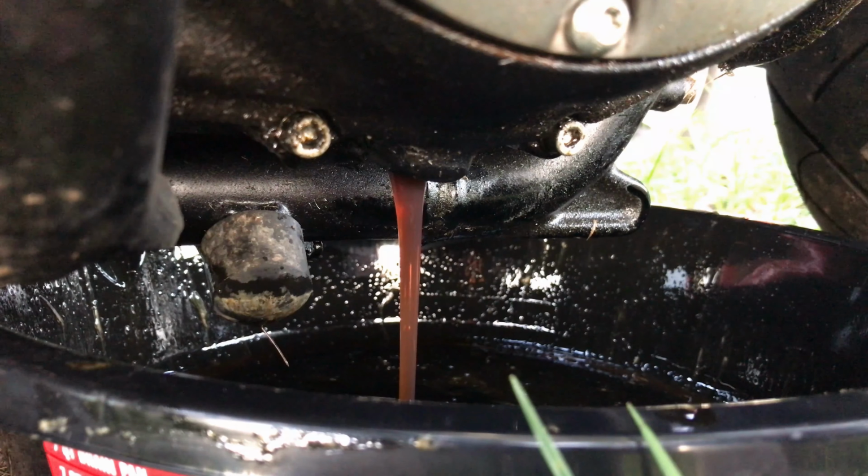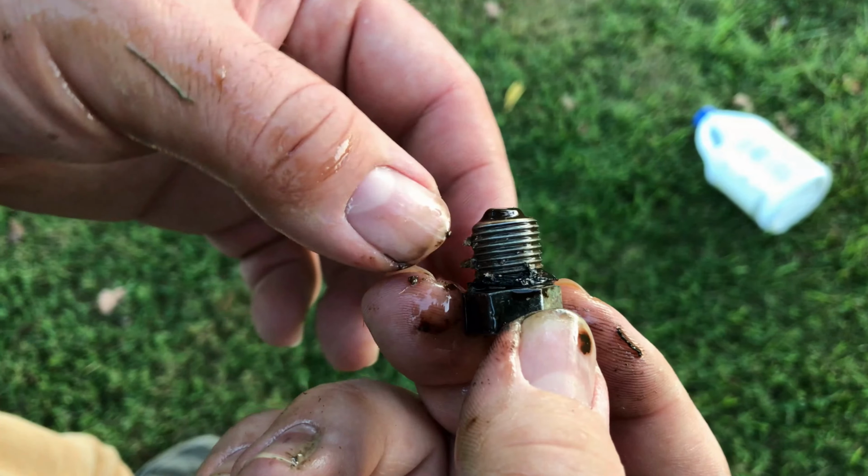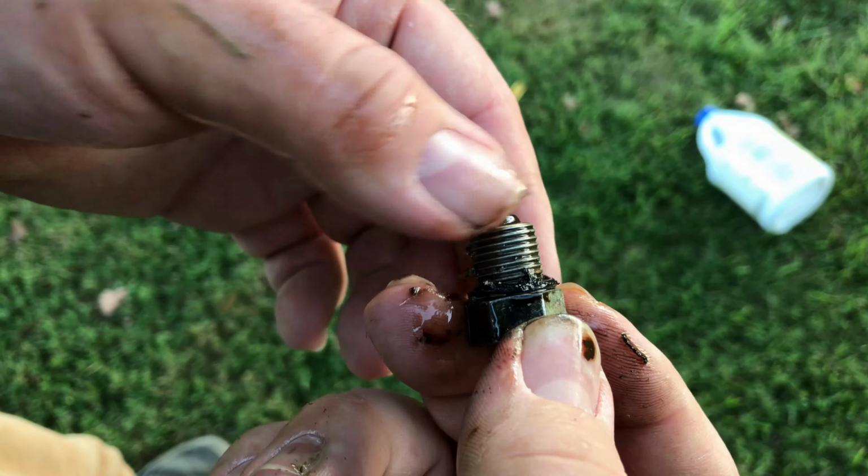the foot peg. And what Patrick is doing there, now this is Patrick's bike, he's turning the wrenches on this one today. He removed the drain plug and now he's going to get rid of this O-ring seal. Now that thing had been leaking. He had been having some drips come out of the bottom of his motorcycle and couldn't figure out where it was at. And come to find out, it was not engine oil. It was that seal on his primary cover had been leaking.